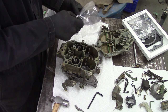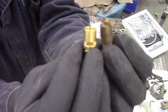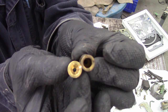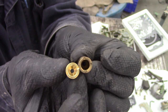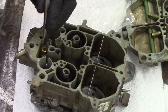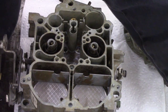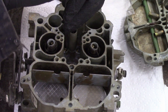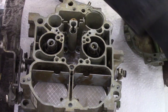The needle and seat looks a little different than the one I took out — it's got open spaces at the bottom, which I think would be good for getting more fuel past the needle and into the float bowl. The float bowl on a Rochester is really small. The bigger the hole, the more fuel it will feed, though it doesn't take much more pressure before it overpowers the float. You want the right size screwdriver so you don't wreck your jets — just snug them, you don't have to kill them; they don't usually fall out.